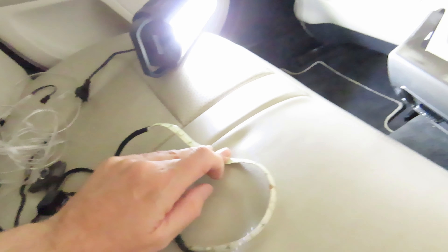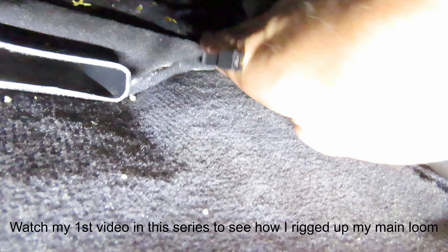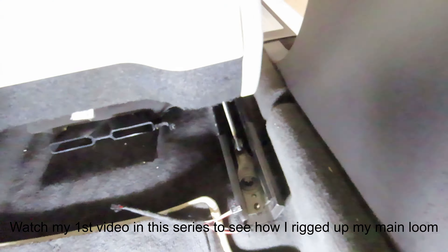To get this off, you just need to unclip the side of your centre console trim — do that on both sides and get your armrest up. Pull up on this; there are two clips holding it in place underneath. Get these clips undone — there are three clips total: one over there, one over there, and one down there, same story on the other side. Once you have those unclipped, they clip into the side of your vent over here.